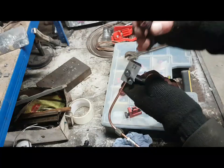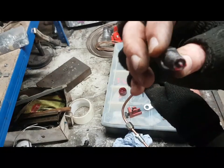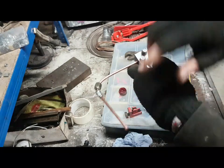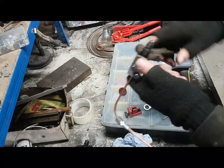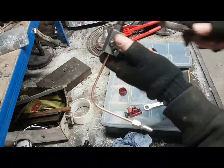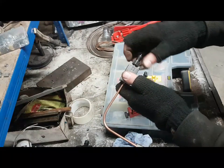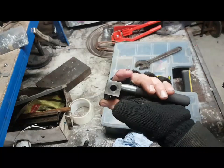First of all, you put the, as if you're making a male fitting flare, so you put the one with the concave fitting in it. So you're going to create exactly the same flare as that one, as you've just done. So you create that, wind him in, tighty, tighty, tighty. He's as tight as he's going to go. Wind him back out again.